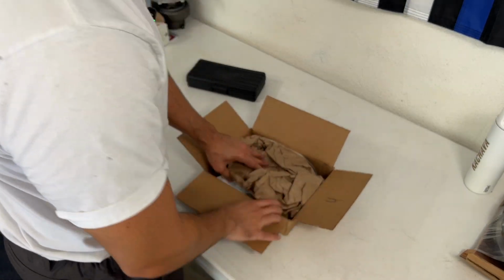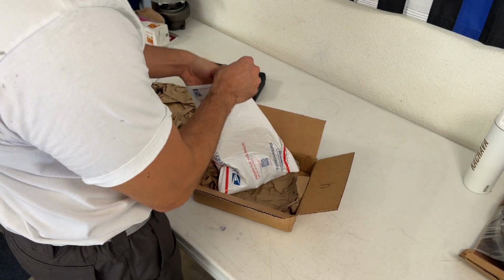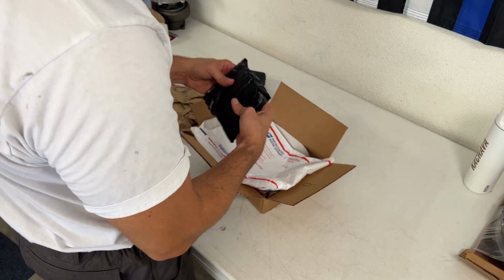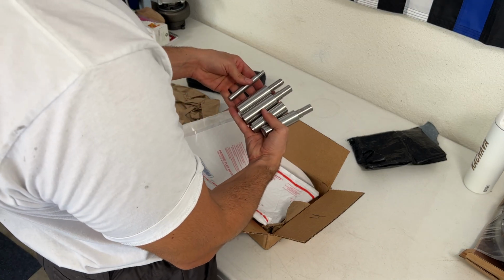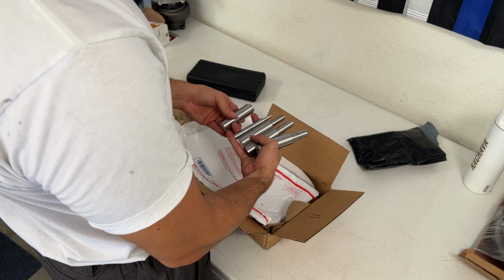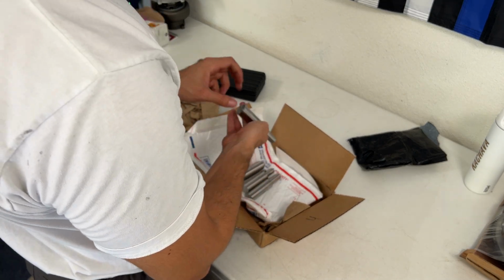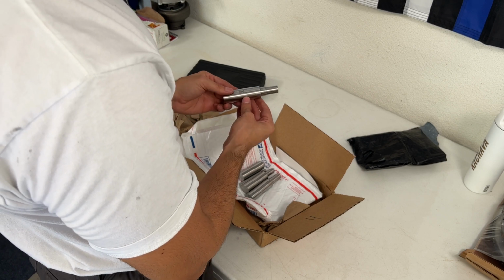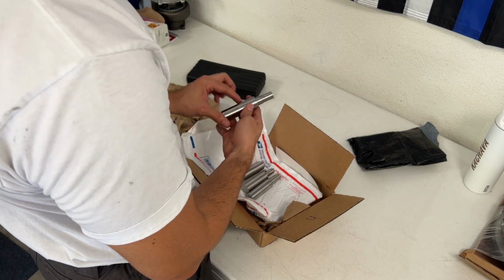So this is what you're gonna need. This is the special tools that BMW requires you to use in order to do these Detent Pins. So 125 bucks, boys, just so we can do these Detent Pins. Jeez. But you're gonna actually use a hammer with these and tap the pins in, and then they bottom out onto the frame of the transmission at the perfect height for each of the pins to sit exactly where they need to sit in the transmission.